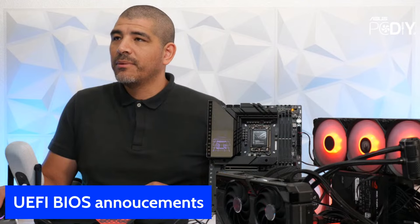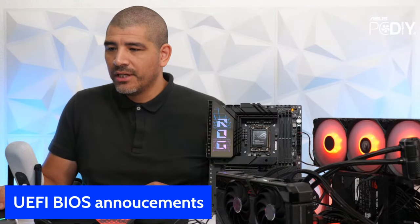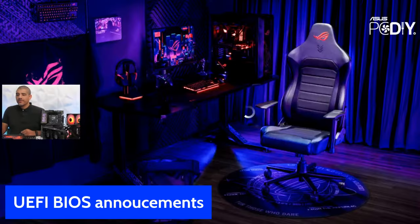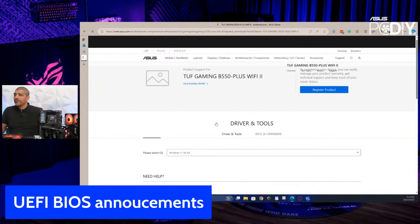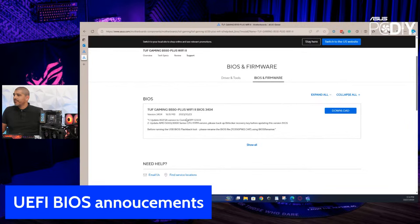So let me go ahead and bring up a model here. Hopefully this UEFI build will already be up for this model. Some of them take about 24 hours to synchronize on the back end, but we'll see. So here would be one of the AM4 boards. This is our TUF Gaming B550 Plus Wi-Fi 2. Okay, so we're gonna head over to the support tab, which is what you would do. Head over to the driver tab, BIOS and firmware, and we can see right here, yep, on one of the most recent boards, you can see from the 23rd of this month, and that new AMD AGESA, that 1.2.0.B release.